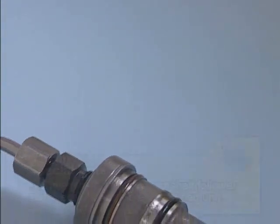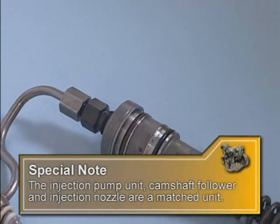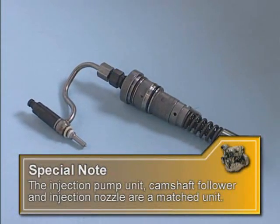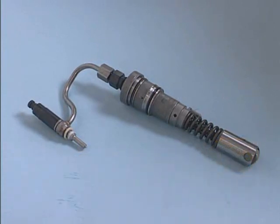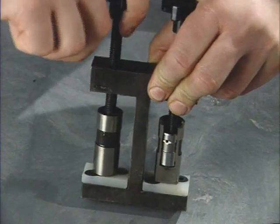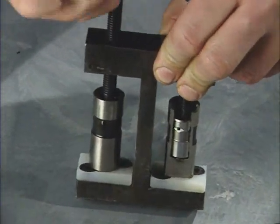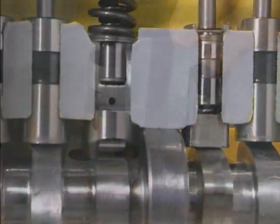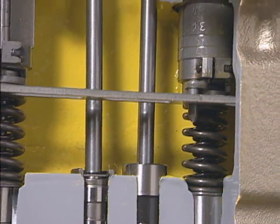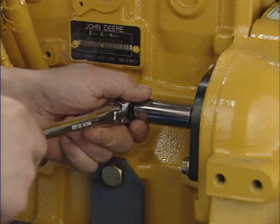Note that the injection pump unit, camshaft follower, and nozzle are calibrated and installed as a matched unit. Mixing these components will result in excessive variation in fuel delivery and injection timing, so make sure the pump unit you install is a matched set before proceeding to the next cylinder. Also note that if the rocker arm assembly was removed, the hydraulic lifters must be bled down. Refer to the valve train instructions to ensure that cam followers and valve train components are properly installed.